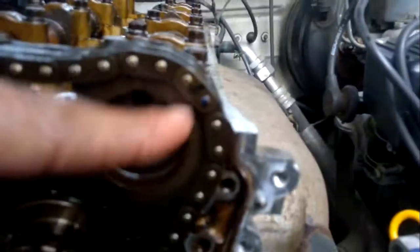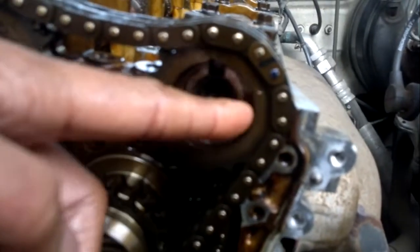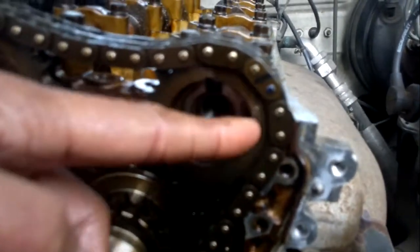Since you really didn't move this around much, right there is the mark — right here. It's on the mark where I put it. So everything seems to be timed correctly. If people wanted to know the positions, I would say this would be at the stock position if you're using an exhaust camshaft, which is obvious.